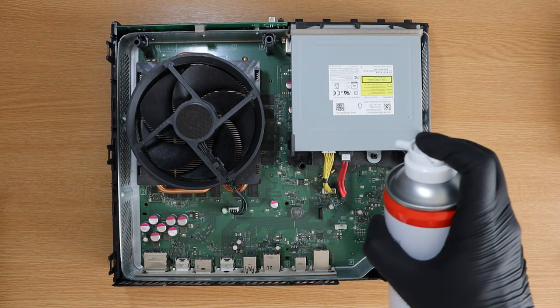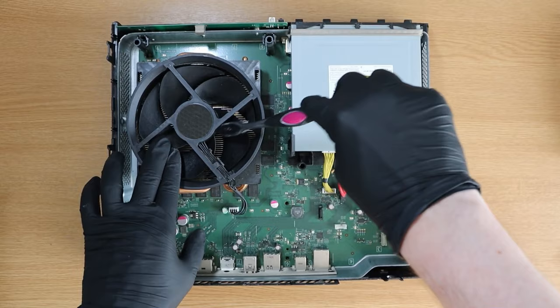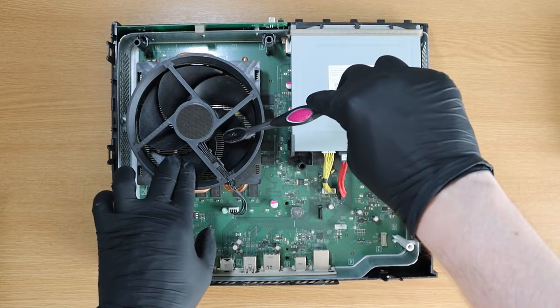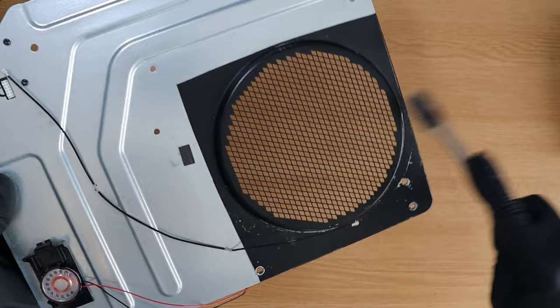This part is pretty self-explanatory. Just ensure that you're in an area with quite a lot of air and room, because if you spray dust in a small tiny area it's not going to be nice and you'll be breathing in a lot. Use the can of air on the motherboard and just make sure you loosen up any dust that you can. Make sure to focus this on the fan as well. If you've got massive clumps of dust on your fan, just remove them with your fingers. Go around the fan with the toothbrush and then use the can of air to get rid of any leftover dust. Follow the exact same procedure for the metal casing and the main case of the Xbox.